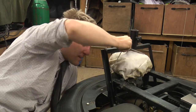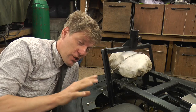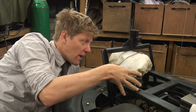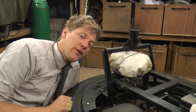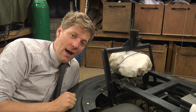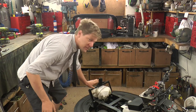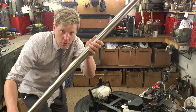Now under here is the petrol tank, and if you're wondering why it's got Ric's mum's shower cap on it - she's fine with it, it's all right - it's because at speed we found that whatever air pressure was going on, it was dragging fuel out of the vent and everything around there was just getting covered in petrol and then getting loads of muck stuck to it. I don't like that, so we put that on - job solved.